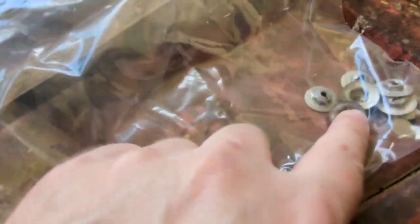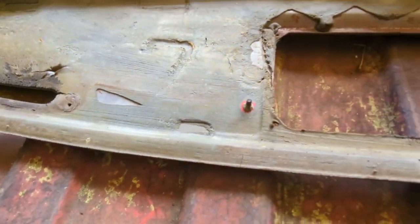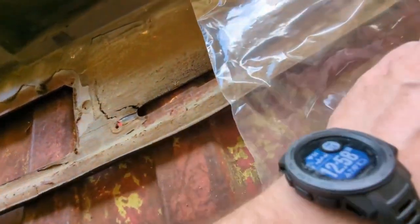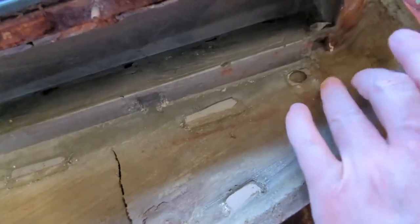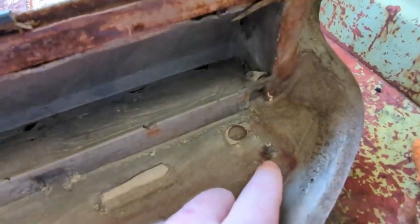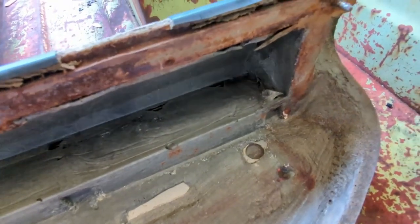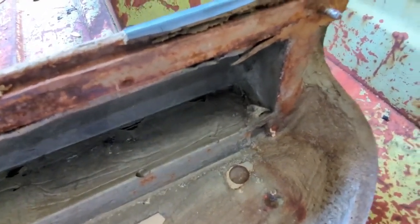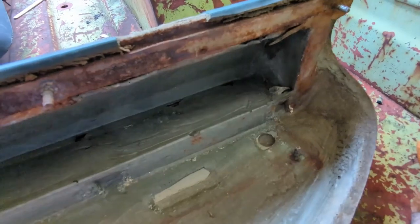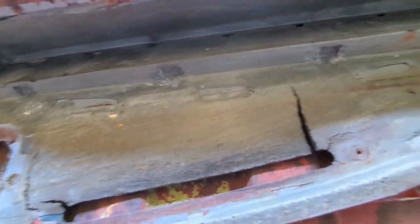If you've ever looked at your gauges, those will look familiar. It's a similar version of those. All you need to take them off is a 3/8 end wrench. Some of them you can get with a 3/8 socket, it just depends. In my case, they all came off super easy, except for these two right here in the corner. You can see those threads are kind of boogered up. No matter how much you turned them, they would turn, but they wouldn't unscrew off the threads. So it took a little bit of extra persuasion to get those off, which made what should have been a quick job take a heck of a lot longer.